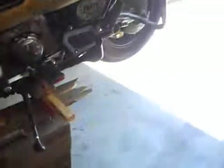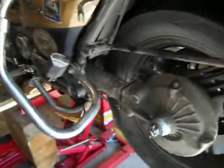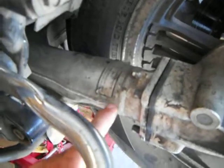All right. So now what I'm getting ready to do is pull the rear wheel back off, pull the final drive back off, and pull the drive shafts already out, set all that stuff aside, and then I'm going to go to taking my swing arm out. The swing arm on these bikes, this guy right here, this hollow tube that the drive shaft goes through, okay, is actually part of the swing arm on these old Ventures.